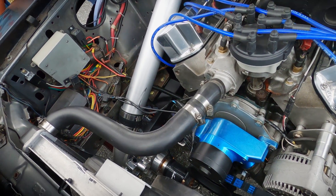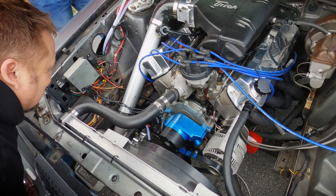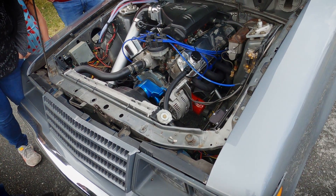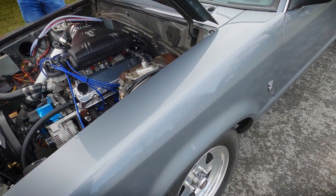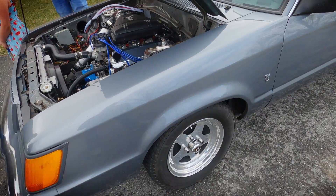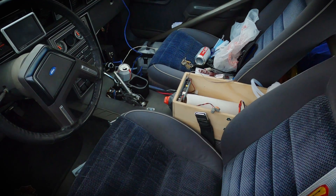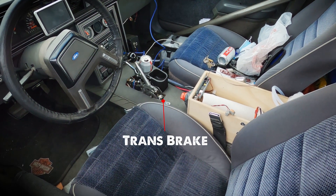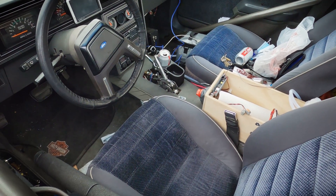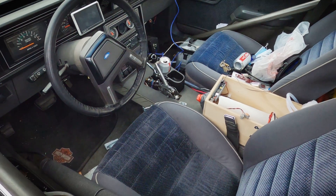Oh, I could imagine. The battery pack is the equivalent of a pound and a half of TNT. I brought my blooper vest. It's in your white truck. I think you'll be okay. It's pretty straightforward — it's just a glide. The trans brake is the button right at the base of the shifter. There's a GPS in there, that little black button attached to the shifter. And then the batteries go in that wooden box; right now they're in that explosion-proof bag over there.